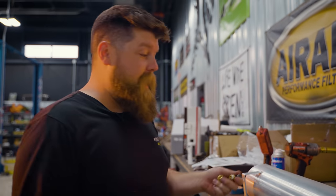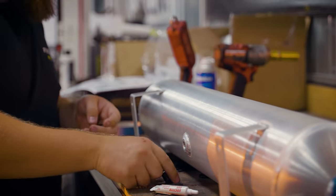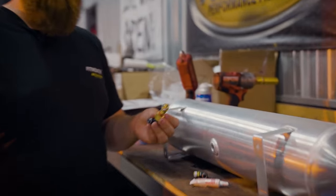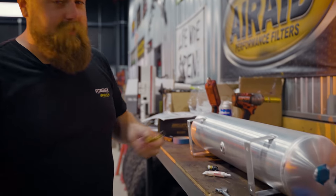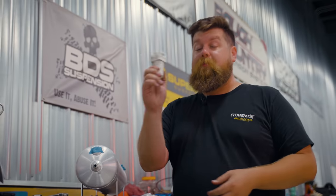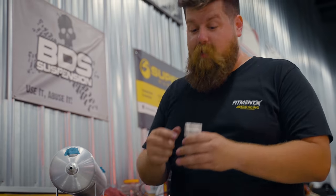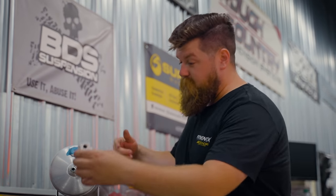When you compress and store air, you're inevitably going to get some moisture. On the bottom of the tank there's a drain. First we start with a 90-degree elbow going into a quarter-inch line, which runs to a T fitting. That T is going to have a pressure relief valve on it just in case pressure needs to be relieved, and another line runs from there to a fill/check drain so you can fill and empty it to evacuate water out of your tank — especially important in cold climates or areas with big temperature differences. To keep water out of the manifold and bags, we also have a water-and-air separator. It's one-way flowing — there's an arrow indicating the inlet, and the outlet points out — so make sure it's in line correctly.